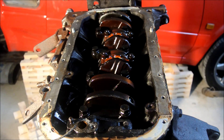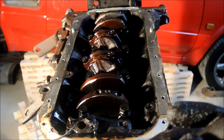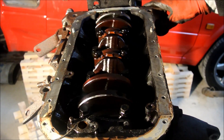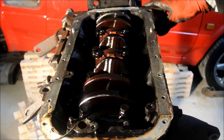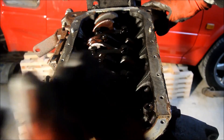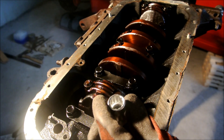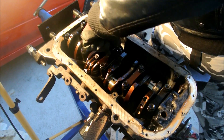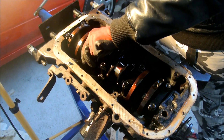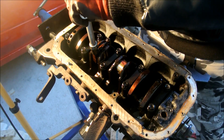Once you remove it, you can take a look at your engine internals — the famous 4AGE. It's a 4-cylinder engine, 81mm bore. The first thing to remove are the connecting rods. The connecting rod bearing caps are the first thing — they are held down by 12-point nuts. You need a 12-point socket for these.